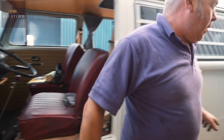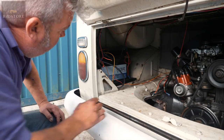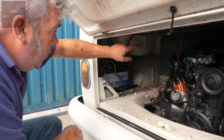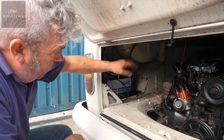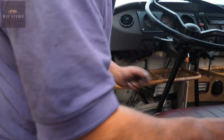Because it isn't connected at the far end, that's not connected. So what we'll do is run a link wire on the outside of the car from where it was to here — that can eliminate that wire. Because possibly there's a short between the front and the back of the car. Let's put our fuse in and try again.